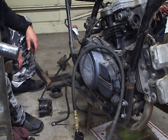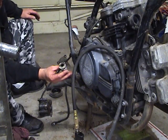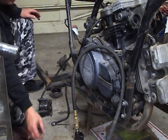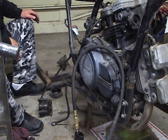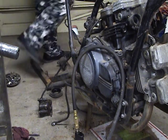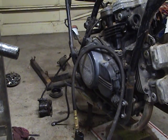Anything else, you try to stick in that head, you run the chance of boogering the head all up, and boy, good luck getting it out then. You're gonna have to blow it out of there with a cutting torch, which is gonna tear up a whole bunch of stuff, but not a big deal. We got the swing arm off. That multi-size Allen head piece will fit quite a few different models, quite a few different years. Nice little piece to have.